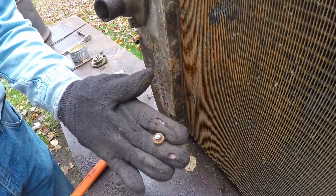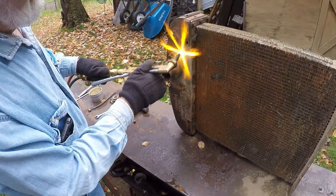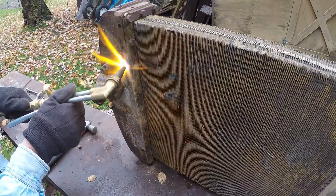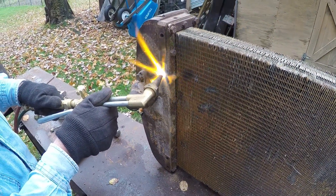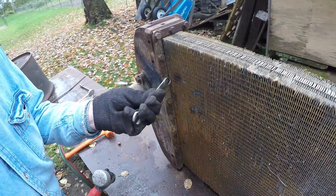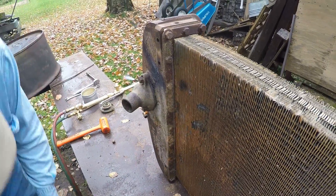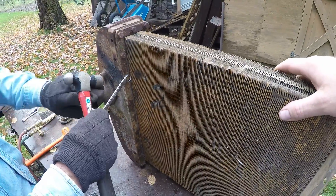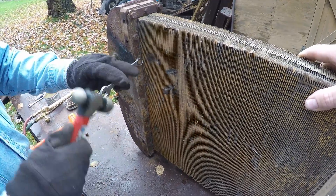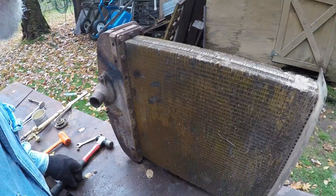There's the first one that broke — we're going to lose a few, I have a feeling quite a few. Let's try some strategic heating on the side of the casting. We don't want to get too much heat around that header plate and melt any more solder out — it might already be compromised. It's a little easier to apply heat to an easy-to-find production cast iron piece than to something with a 10x casting mark. Still sounds fairly solid, but I'm betting we're going to twist the next one off too — yep, there it went.